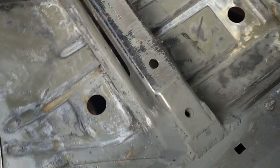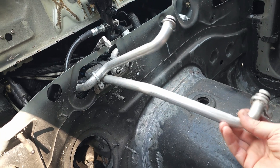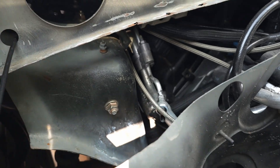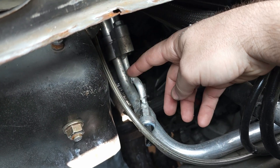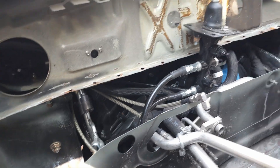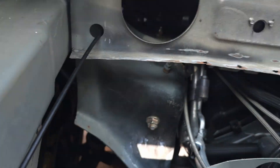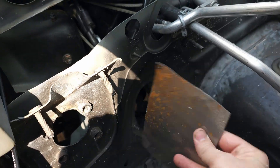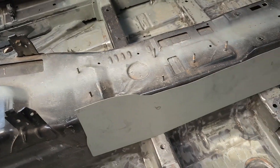Here's a better look — everything kind of welded in, super solid. So here's the water lines for the heater core, so I'll be able to have some heat and AC. I did have to modify the AC lines — I had to relocate the pressure sensor from here down here. This was originally shooting off sideways and hitting the strut tower, so that didn't work. And the brake master cylinder is just chilling up there out of the way while I work on getting some patch panels fabricated. That's rusty, but I've got to patch that in and get all that stuff sorted before I weld the firewall piece in, because once I do that I won't be able to get to anything at all.